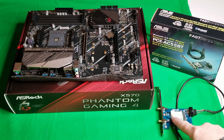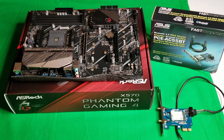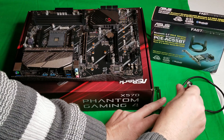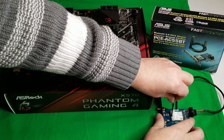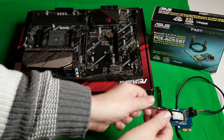All you have to do is unscrew it here. Then you put it onto your motherboard and it's going to function the exact same way as if the adapter was in it. It's AC 1200, so the latest standard with pretty good speeds, and that's what you're going to want. You just undo the screw — they're pretty tight because they didn't plan on people taking it out — so be careful in case you want to reuse this in the future.